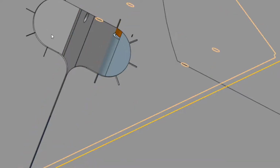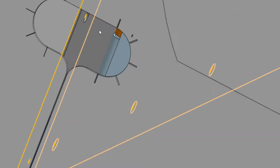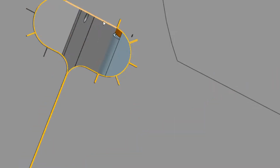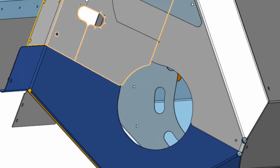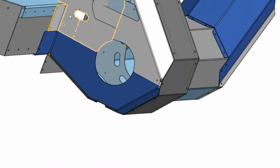And we really want a little bit of clearance all around there, but in case it should shift and make contact with it, I'd rather it be a blunt side face of one of these than the actual hard edge of the thin tin. Don't want to abrade that line and take any chance on losing your engine oil through that, since that is engine oil that's lubricating the turbocharger bearing.